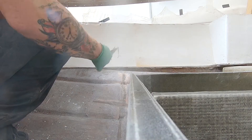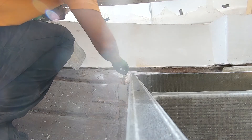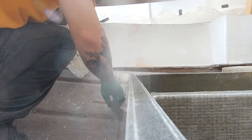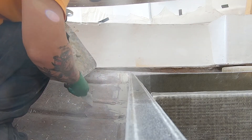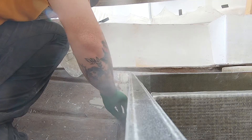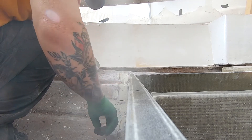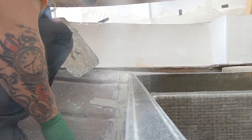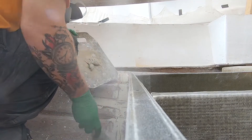In this next step I need to fill in some of the voids created by the original stringer section. I'm using an isophthalic resin — resins come in different grades. You have regular boatyard resin as a base grade, then some steps up from that, then isophthalic resin, and then vinyl ester resin. I use this isophthalic as a core bonding and general bonding compound. It's got great adhesive properties and I'm using it here just to fill in these voids. Then we'll come back and lay the glass over this filler while it's still tacky — you really want to do it all wet on wet with polyester resin.